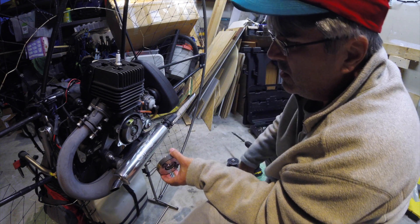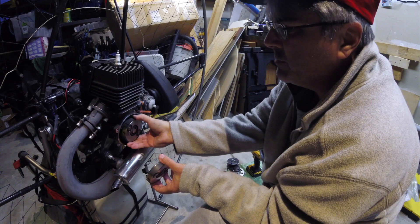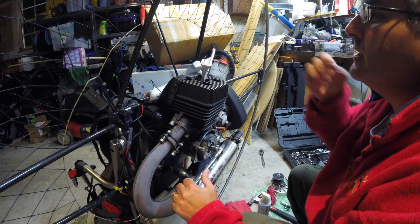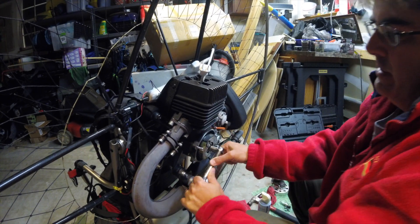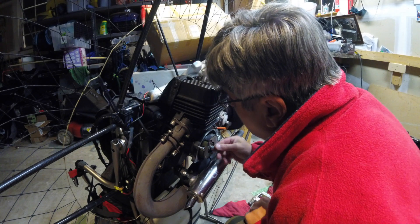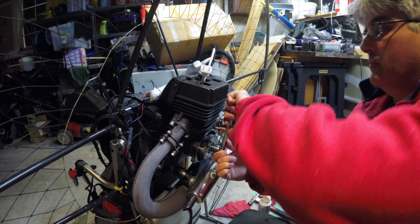I did confirm with Travis at Air DeFore that it spins this way to come off. So that's where I need the impact wrench and I don't have that with me right now. A little trick I learned on the internet — if you don't have an impact wrench, stick a cord down in the spark plug hole and it'll bind the piston without damaging it. Then you can unscrew the bolt to the clutch. It's coming off without a problem.